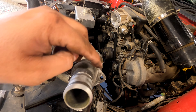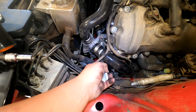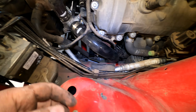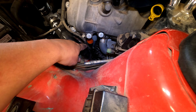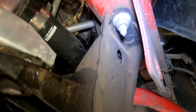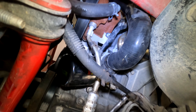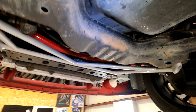Then we'll tighten down these eight millimeter bolts. We got everything started - leave it all loose like I said because obviously this isn't how it's gonna end up. Now we're gonna get under the car and get this hose here mounted. We got everything in - you need to be conscious of one thing: the pulley on the power steering pump. Make sure it's far away from all the hoses.